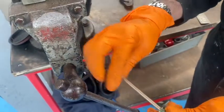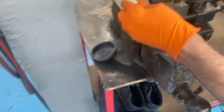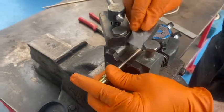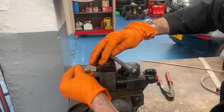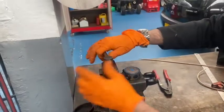Before you start doing the other side, always make sure that you put the other brake pipe end on first — that's a female end that's going to go on that end. Make sure that it's on the correct way around. With the female end, what we have to do is again pop it in there and have it just about flush, maybe sticking through ever so slightly.